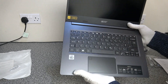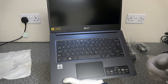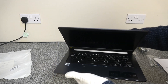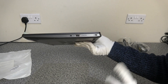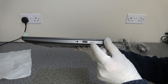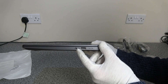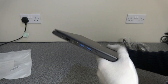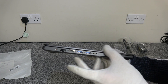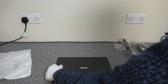It's got nice soft touch keys, a mouse track pad with a fingerprint reader and the on/off switch. We've got an HD webcam up top. For connectivity on the side, we've got a Kensington lock, power light and hard disk activity light, a USB port, and a headset jack — that's headphones and microphone combined. On the other side we've got a USB Type-C Thunderbolt port, two USB 3 ports, HDMI out, gigabit network connectivity, and the power adapter slot.